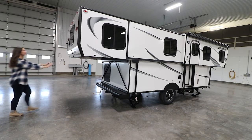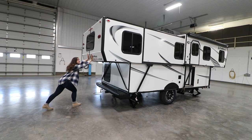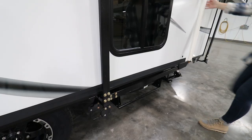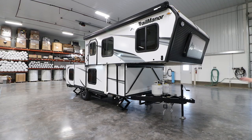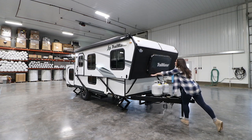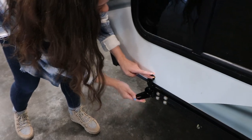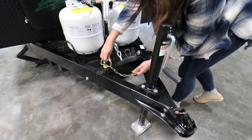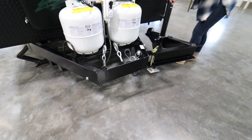When you're ready to get back on the road and eventually store your trailer, you simply reverse the process. As you close up the two sections, a gentle push is all that's needed. Lock them back down into place by using your weight and pushing down on the footholds on each side. Remember to attach all the travel latches. For storage, the swing hitch takes a simple unpinning and rotation, which will shorten storage length by two feet.